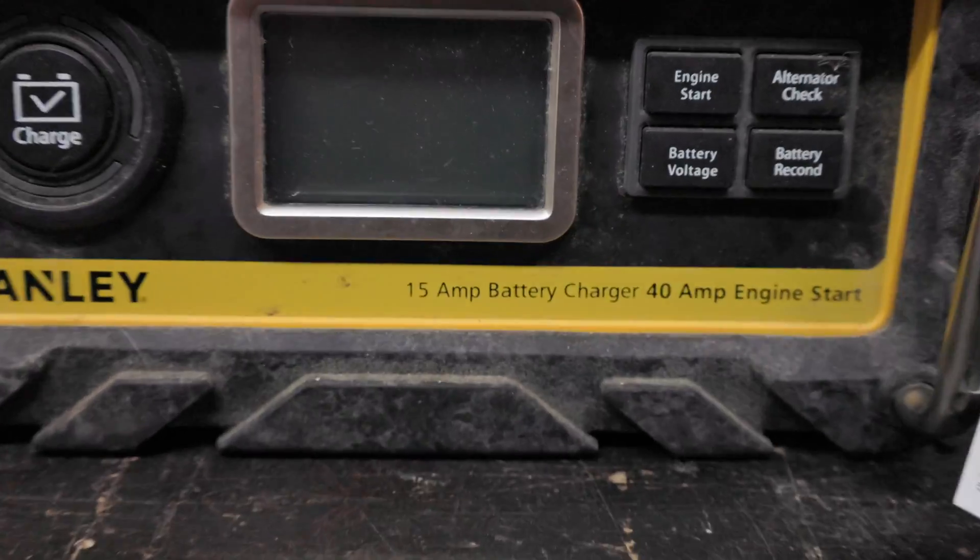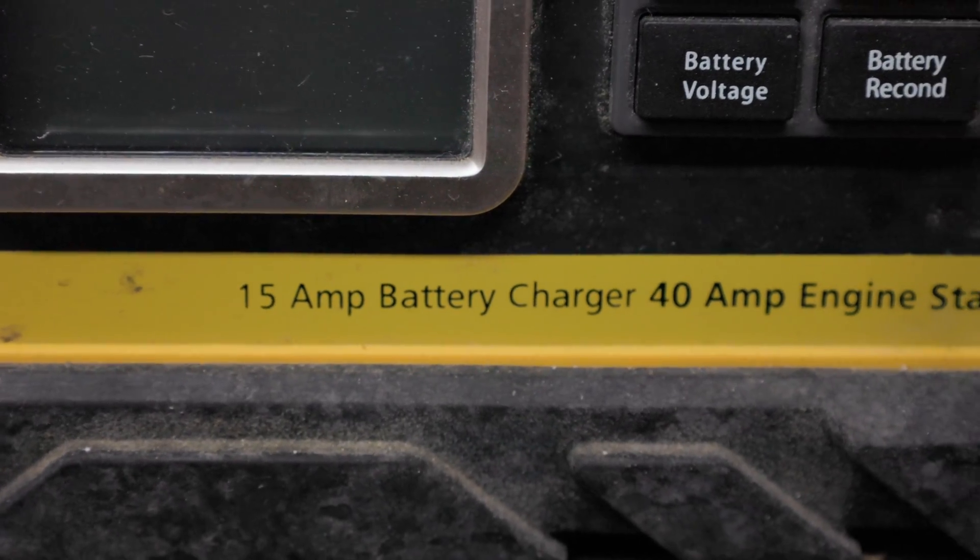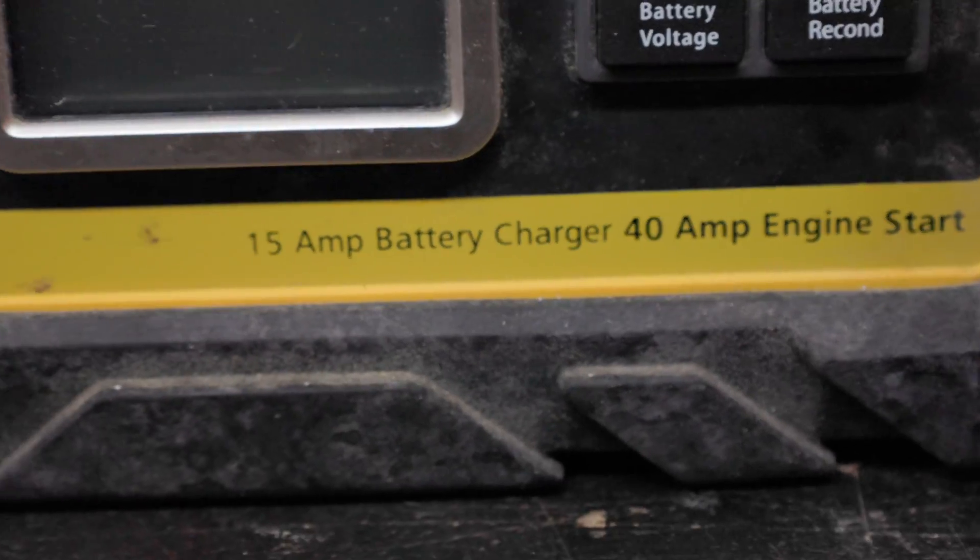If you're going for a battery that's completely dead, you're going to want to go with a 15-amp charger or something in the higher range — so let's say 10 to 15 amps if you're charging a battery from dead, versus two to four amps if you're using a battery charger maintainer built into one for maintaining batteries in your vehicles.